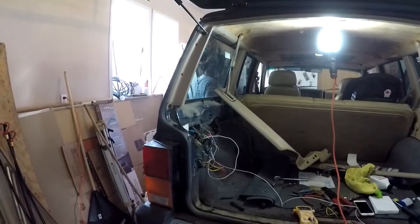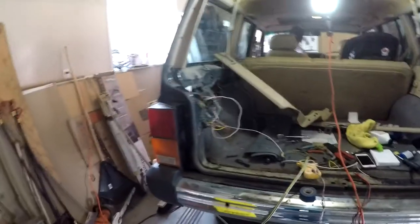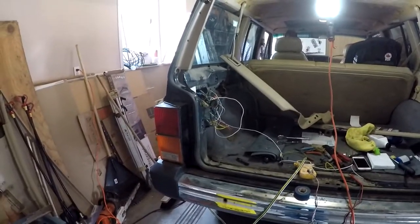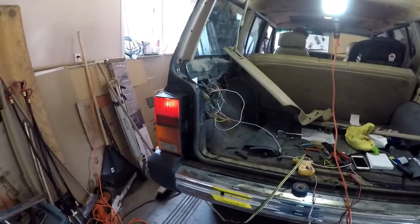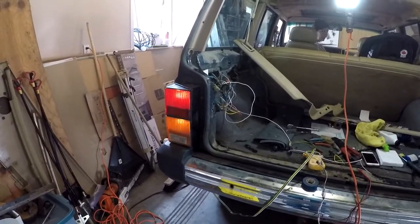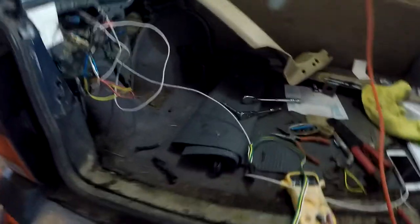All right, so trailer wiring is all hooked up. It's kind of loosely there right now, but it's all soldered and good to go. So now we just need the wifey to push on the brakes. We have brake lights. Okay, pull your stick out. Pull my stick out? Yeah, the thing. Pull the thing out. My light toggle? Yeah, okay, we have that. Turn signal left. Turn signal right. Excellent. All right, I'm going to test this now.